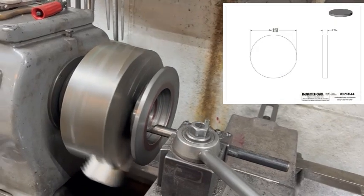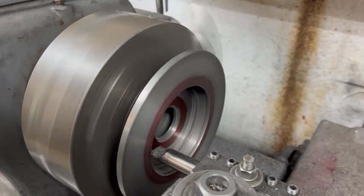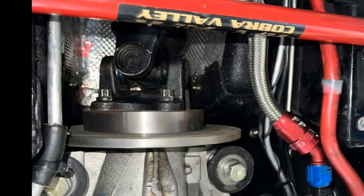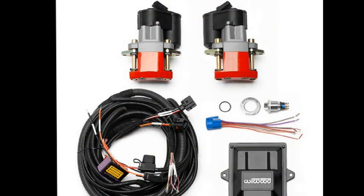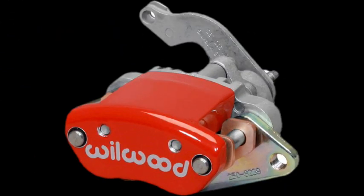To say the least, this was a very cool project. It took a fair bit of head scratching to produce a good plan. We needed to make a new brake rotor that would relocate the caliper behind its original position, but still have it tucked up very close to the drive shaft, still leaving room for the drive shaft safety loop. In the middle of all this, Casey was looking at other emergency brake systems. He found out that Wilwood had just come out with a new electric activated emergency brake caliper. This immediately got his attention — he was thinking this might be far easier than using the cable activated Wilwood caliper that usually mounts on the brake rotor. It was a no-brainer for us to order the kit. It was much easier working with this than the old cable-operated one.